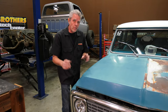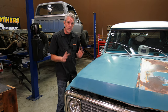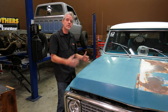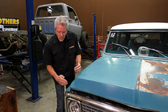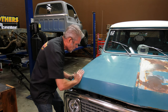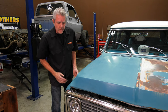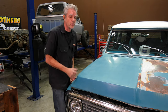If you're concerned about your paint, you're going to want to get tape up on here and make sure it's all protected. It's also good to get a buddy to watch one side while you're watching the other to make sure nothing gets scratched. Once the hood's down far enough, I can see how I'm lining up. I can see this is a little bit too far forward, so I can just gently bump it back until it gets lined up. You may have to loosen up the bolts and do it a few times, but you'll get it right.